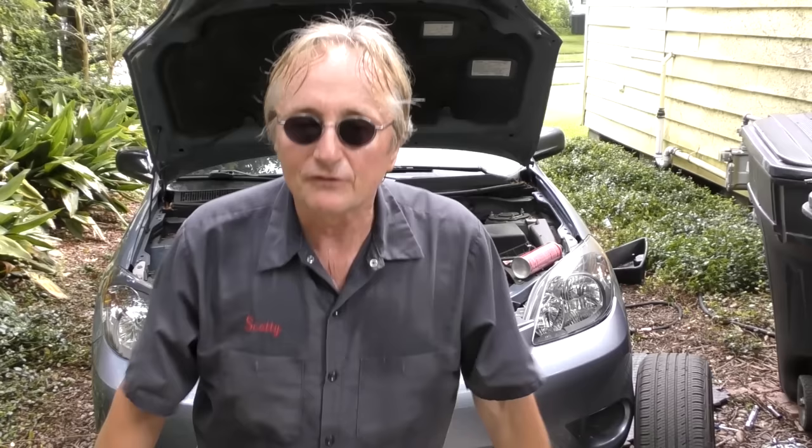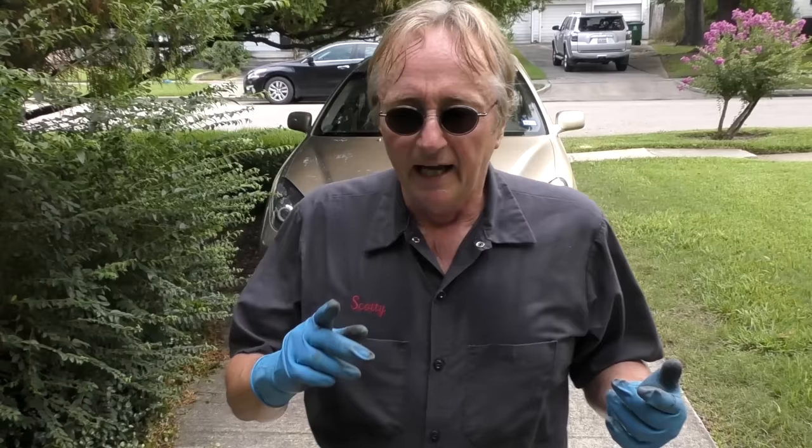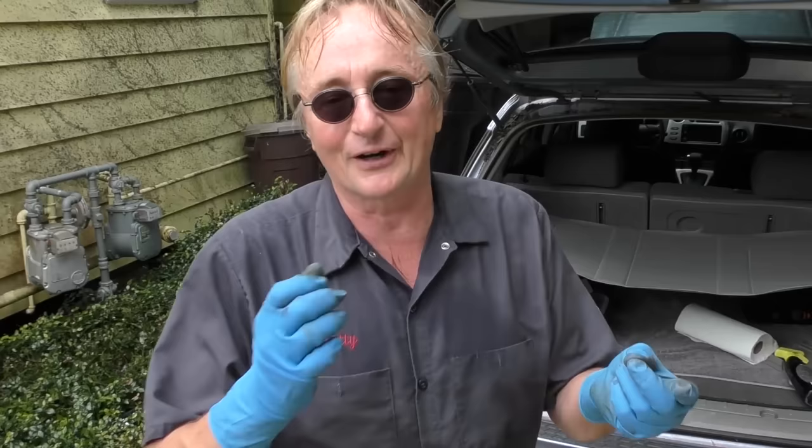The absolute top tip for making your brakes last as long as possible is to brake conservatively. Years ago I had a customer with a BMW — I kept putting brake pads on it like every nine thousand miles, and I was using BMW pads from the dealer, so I wasn't using cheap pads. When he came over for the next brake job and they were already worn thinner than a dime, I said, 'Let's go for a ride.' I watched him and noticed he had one foot on the brake and one foot on the gas. He said at school they taught him to use one foot on the brake and the right foot on the gas for an automatic — but he took it too literally and left his foot resting on the brake the whole time. His brake light was on constantly, which is why he wore the pads out so fast.